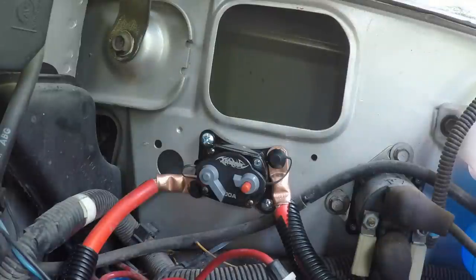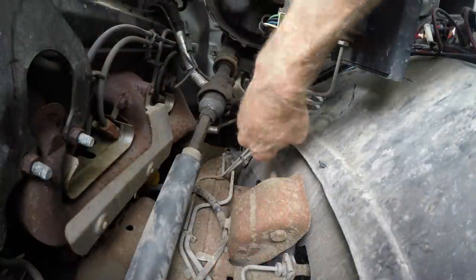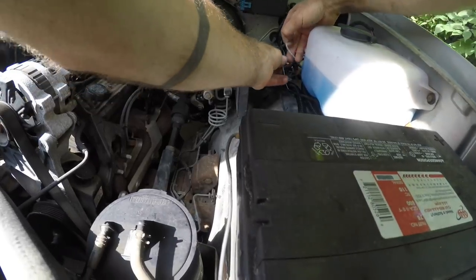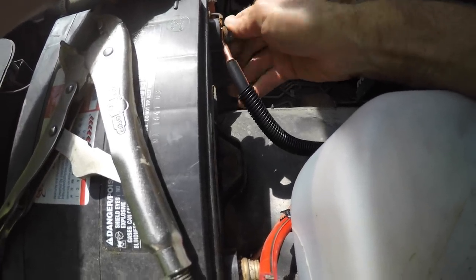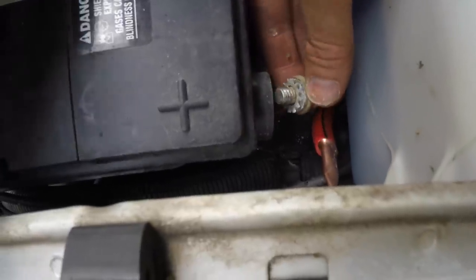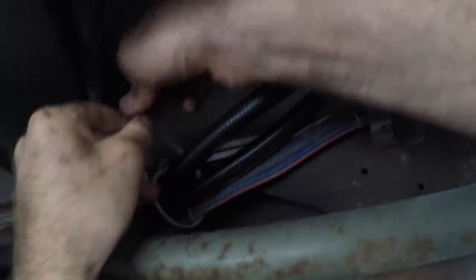Here you can see how the switch breaker works — it's off right now, and if you click it together it's connected; click the little red button and it's disconnected. Next I ran the ground wire up into the engine compartment. Wiring like this, it's always good to hide it off to the side, think about where you want it ahead of time, and use plenty of zip ties. I connected the ground wire to my second battery — in some setups like a van you might call this your leisure battery — and then connected the hot connection. At that point, everything up front was pretty much good to go, so I got under the truck and started running my wires, grouping them together with zip ties and running them alongside all my other existing wires that run to the back of the truck.